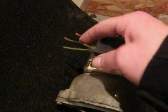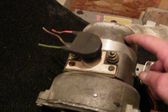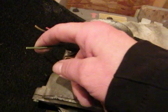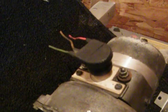Your red wire, which is your main power wire, your brown wire will then be grounded on your new alternator, and your green wire will also go onto a post at the back for an internally regulated alternator. I hope that makes sense — you can always send me an email and I'll gladly answer any questions.